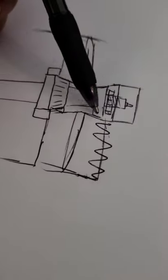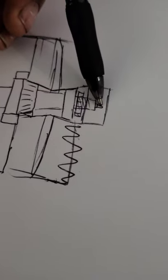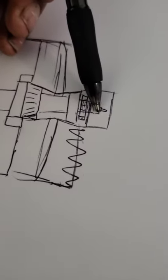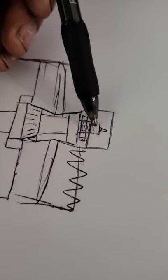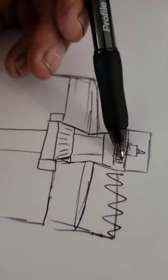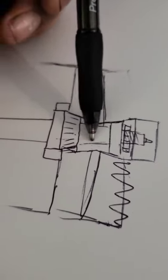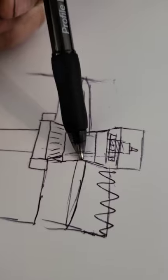I've drawn a diagram of what the inside of the brakes looks like. You have your inner bearing and your outer bearing, and your grease nipple where you enter grease. When an RV tech or mechanic services the bearing, they'll pull this whole hub off — this is your brake drum assembly. When they repack it, they fill the bearings so the grease fills about thirty percent inside.